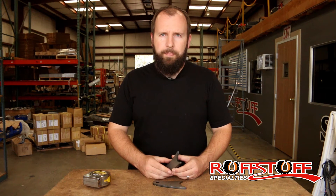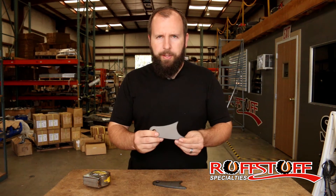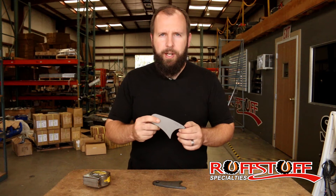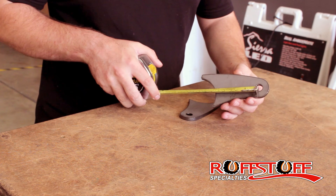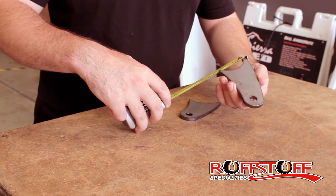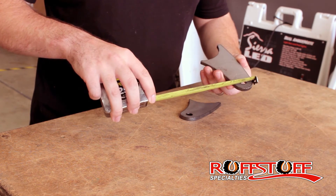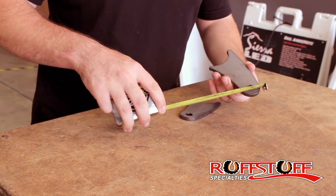To make them even stronger you can box them in, really get creative. These can be mounted below your axle, off the back, off the top — you can cut them flat and mount them to a truss. There's a lot of different variations you can do with these tabs and they're very versatile. The radius on this is three inches from the center of the mounting hole to the top of the axle tube, which is right around three and a quarter inches. The base here is about two and seven eighths inches for reference, and they have a lot of material around the bolt hole — about a half inch — to keep them from tearing apart when you're out wheeling.